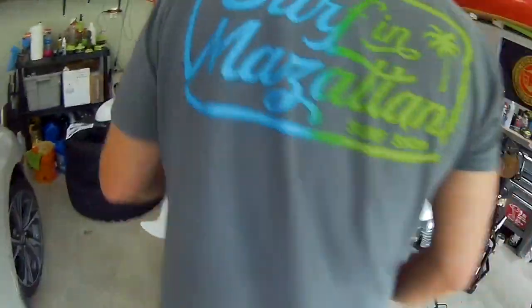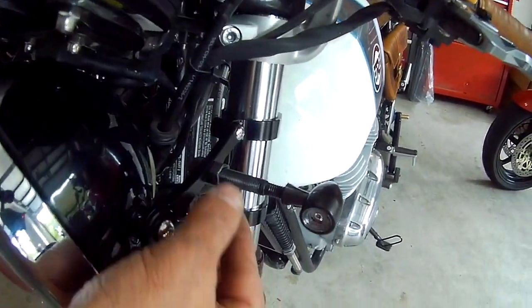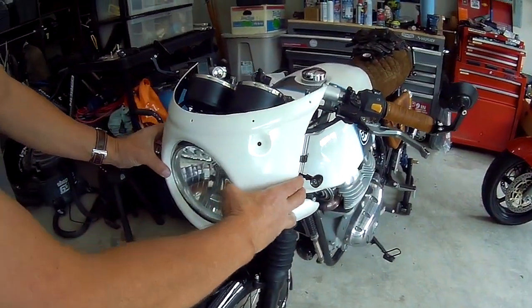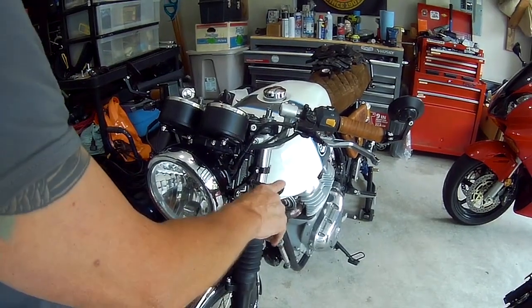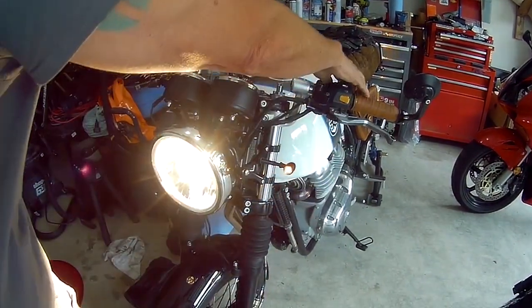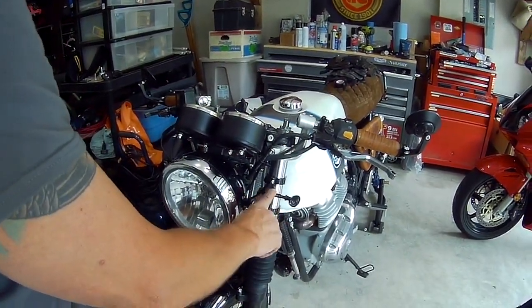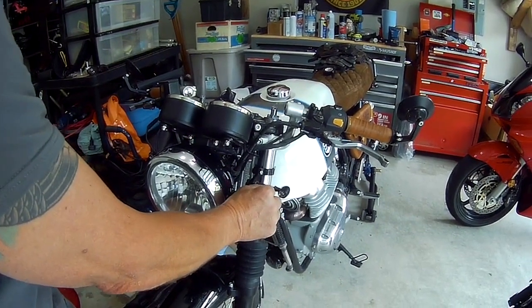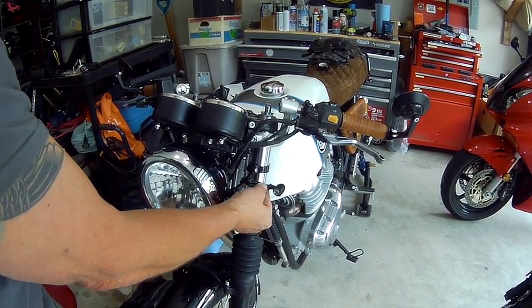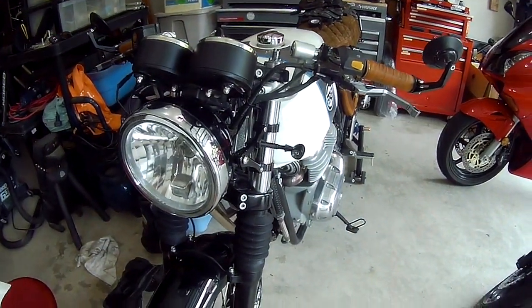Now what we've got to do is mount it up. I should also state what I've done with these signals — I've extended them out so they'll clear the bracket and the fairing when it's installed. I'll put a link in the description to these signals. They're quite bright. What I did was I ordered a 10mm hollow sleeve, drilled it out a little bit, then JB welded one shaft into the other, and ran my wires down through it and mounted it like that.